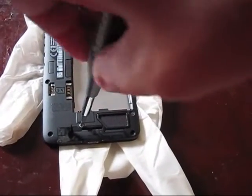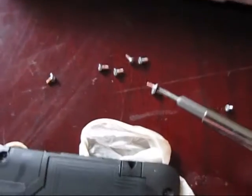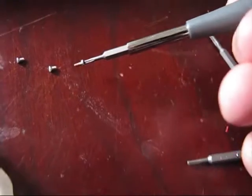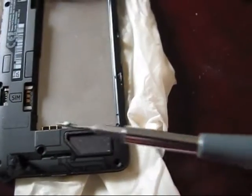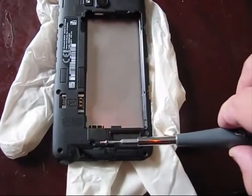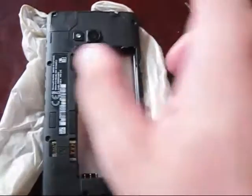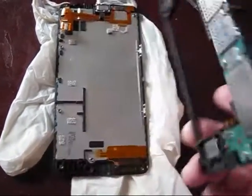This T5 bolt is the same size as the body of the phone itself — not the small one, it's larger, like those six. It was located under this sticker. Remove it. As soon as you have removed this last bolt which is under the sticker, and you have disconnected the cable I mentioned previously, you can take the back cover out of the way.